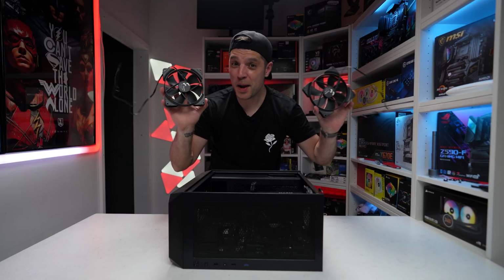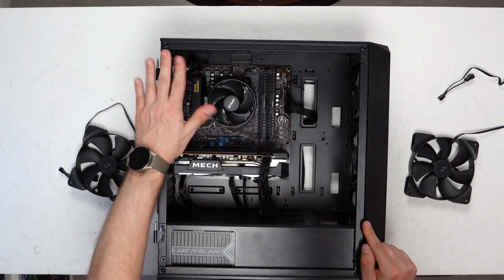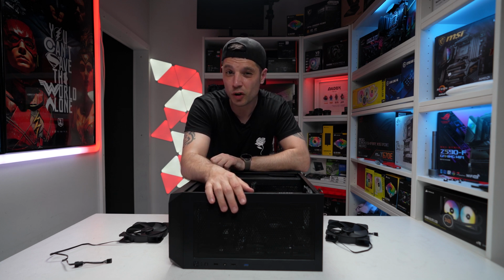Might be a good opportunity to install 2 140mm fans at the top here. At the minute I've got 3 intakes one side and an exhaust at the back. These 140s will provide some really nice exhausting out the top here as well. And seeing as they've not cost anything and I've just got them sat on the shelf, let's add them in before we do a test boot.